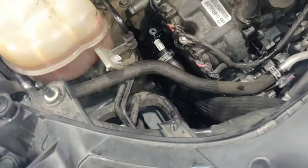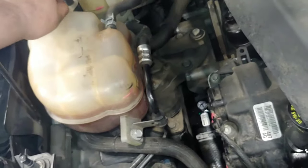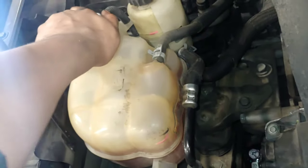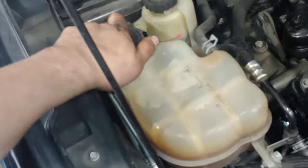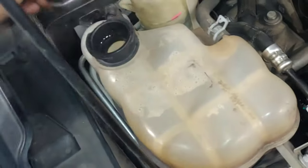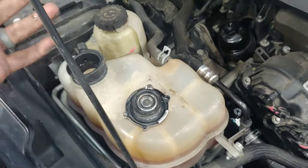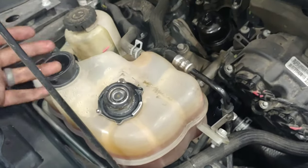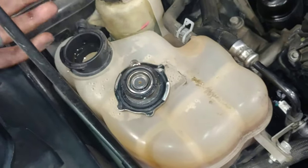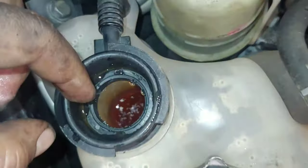So basically done. From here all you really got to do is top off the coolant, and it's a good idea to bleed the system because you'd be surprised what a small amount of air can do to the system. Sometimes it's not good enough to just fill up the system — let it run, let it get hot up to operating temperature, leave the cap off so it can kind of bleed itself, and sometimes you can even notice some bubbles form.